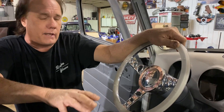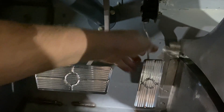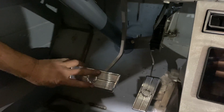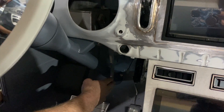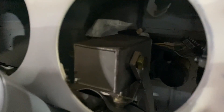I'll have cruise control in here, which is one of the beauties of drive-by-wire. The other benefit is we don't have to have a cable bending every time we tilt the cab — it'll literally just be wires. We're using a GM pedal assembly but I cut it right here and made from here down. This is a Camaro pedal — it uses the stock spring — and the sensors up here I'll cover with upholstery. This is also a GM brake pad like a 68 Camaro, and I made the whole pedal assembly — welded a back plate on it.